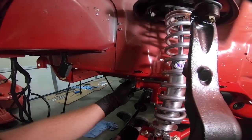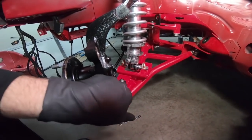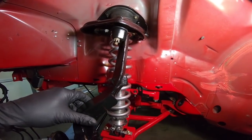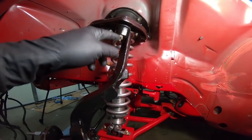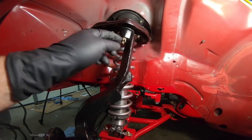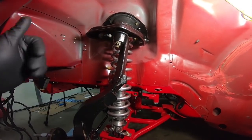We're going to have some work to do on the inside. Before I grab the brakes and put them into place, I'm going to go ahead and torque the bottom ball joint and the upper ball joint, because it may be harder to get in here once the brakes are in place. The bottom one is 81 foot-pounds, the top one is 39. You're going to have to align your cotter keys, so make sure you don't back it off — you might have to move it just a hair in the tighter direction.